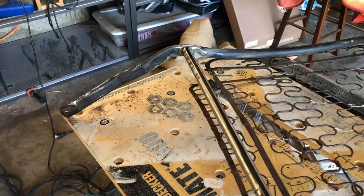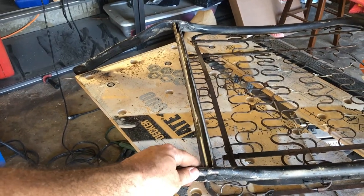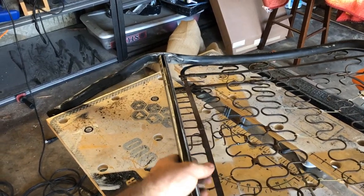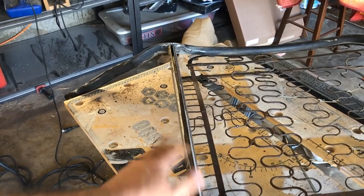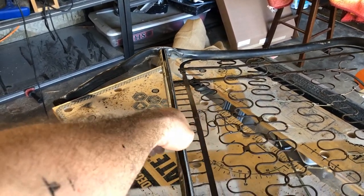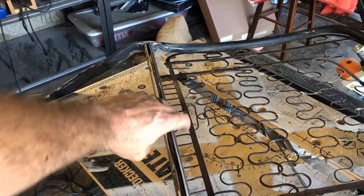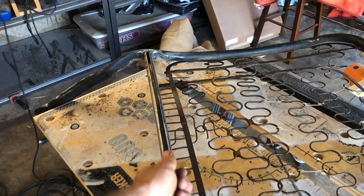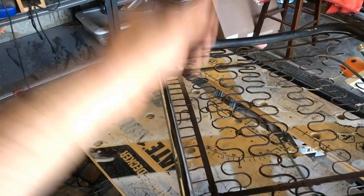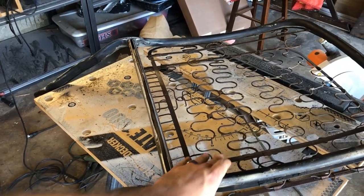I'm really pleased how this turned out. I'm not the best welder or whatever, but that's what working on cars is all about — learning and having fun. I welded in this pipe, cut a little slit in it, so what's gonna happen is the cloth is gonna come up over this area and then up underneath, and it all gets locked down into this channel that I cut. Sanded it down, it looks like it's gonna work. So I'm gonna go ahead and sand this, paint this, then we're gonna put on the burlap, followed by the cushions, then the vinyl, and then we're done.